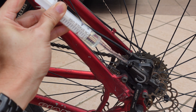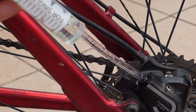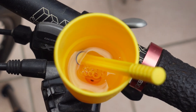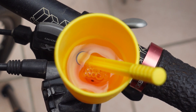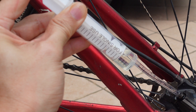Gently push down on the syringe and be mindful of the bubbles. If you see any bubbles going down the hose, stop before the bubble goes inside the caliper. In the reservoir, you can see bubbles bubbling up and different colored fluid coming out from the brake reservoir. It is okay as long as both are the same mineral oil — they can be mixed.